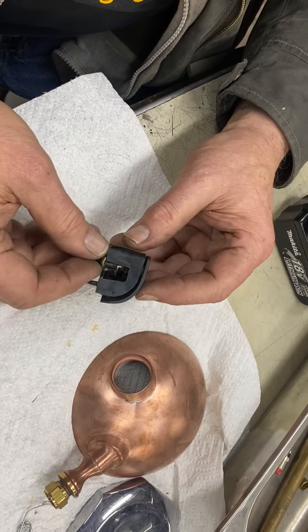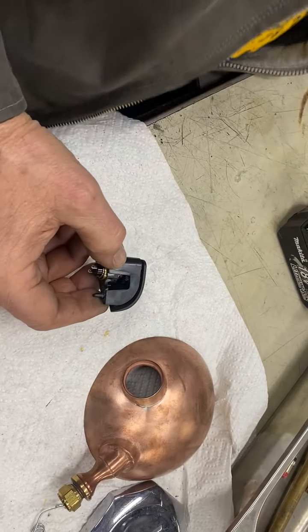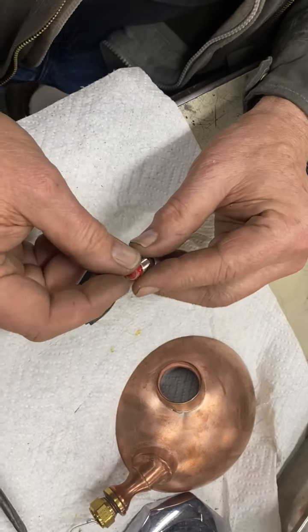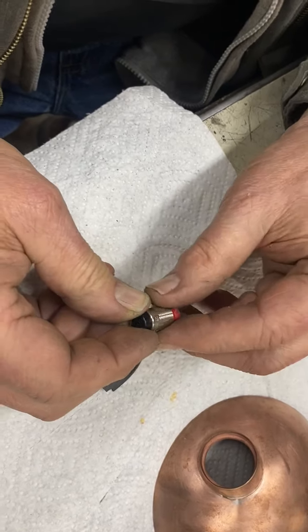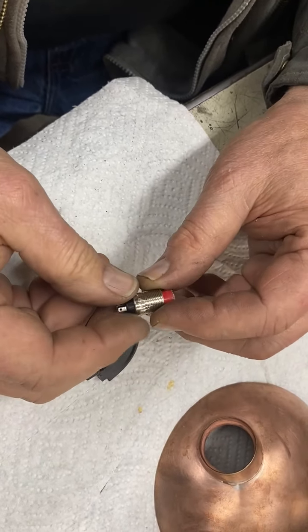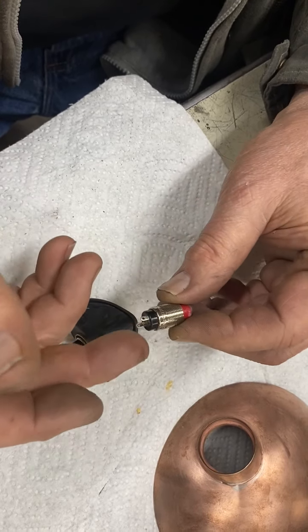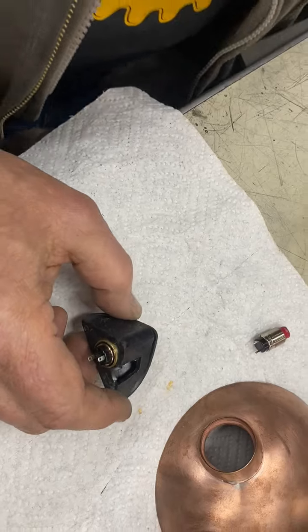The original system had a tendency to break all the time. We now have a replacement switch that looks like this — it's a readily obtainable momentary contact switch with two terminals on it, pretty simple. It easily handles the amperage load of a relay, and probably even a direct horn.